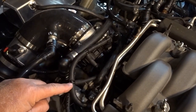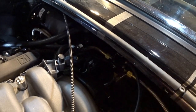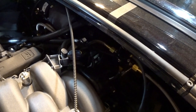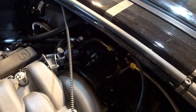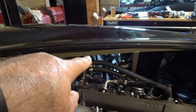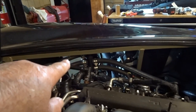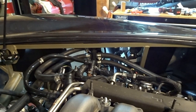I've put two T's in - a T here and a T here. The first T actually goes back to our fuel pressure regulator that we have mounted on the firewall, and that's to provide engine vacuum to the valve so that when it sees a loss of vacuum, it raises our pressure on our fuel pump or fuel line. The other T goes over to our vacuum switch, which is located in the fender well, and provides vacuum to our vacuum bellows for our 4-port valve over on the side of the engine bay.